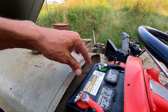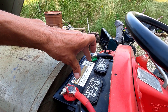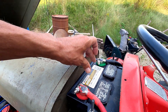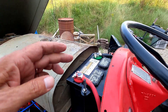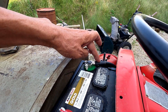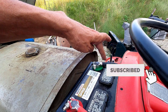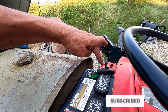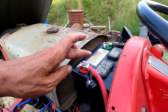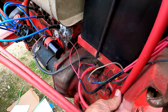We'll start here with the battery. What you've got to do is get the best battery you can get that's the exact same size or pretty much the same size as the original, but in 12-volt. Then you take your cables off — this used to be the positive — so you measure both of your cables and then just reverse what they were. The negative now becomes the same length as the positive and the positive becomes the same length as the old negative was. This one really seems too long but I'll tuck it back here.